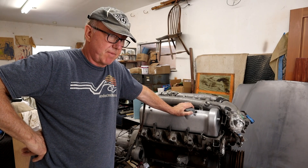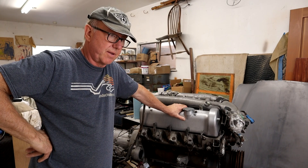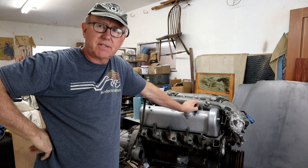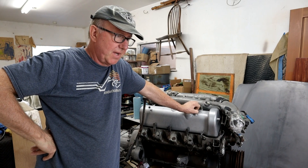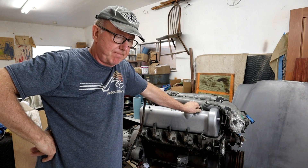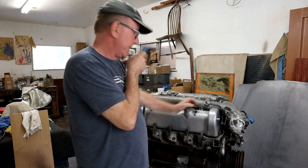I did do a leak down test already so I know what I'm going to show you today, but I thought I'd demonstrate it and show you what we've come up with. The debate is that optimally the engine should be warm, but from the numbers I've already gotten it seems like it's telling me something. I've read both opinions — some say leak down testing a cold engine is essentially useless, and then I read an article from what sounds like a very experienced engine builder saying the only way to do it correctly is on a cold engine. So take it for what it is.